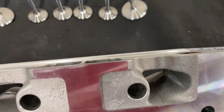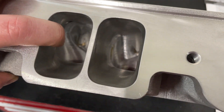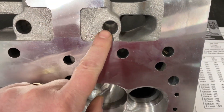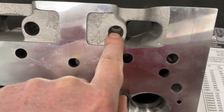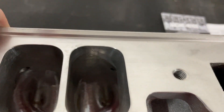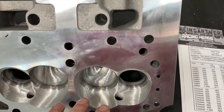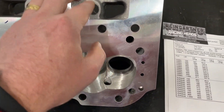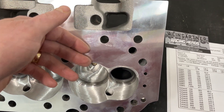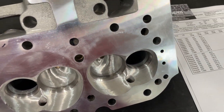I did not touch — someone's going to say why didn't you touch the pushrod pinch. The pushrod pinch is right here. The reason why is I'd already been to AFR and the distance between here and the inside of that port is 35 thousandths. So if you go grinding on that you're going to break through. Also he wanted this done quick so you get what you get. For the full job I would have gone in through here and widened it out bigger over the short side and made it all blend together — it would have been better by a few CFM for sure.